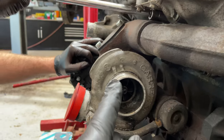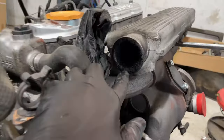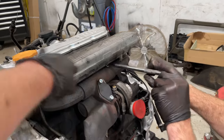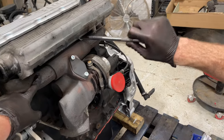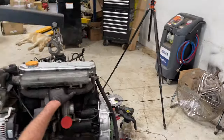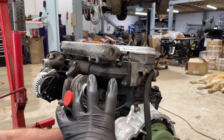So we're essentially now going to be removing the inlet manifold. We're going to be cleaning that because the EGR has made a bit of a mess inside there. We blanked that off as part of the conversion. You can see all the coking up of it. We're removing that, cleaning it out, giving it a spritz of silver. Then we can get to the turbo manifold itself. We'll remove that. We'll remove the turbo drain feeds. We'll spritz this black. We'll change the cartridge, which is there, and we'll spray the outer casing in an aluminium silver. We should be able to get to the block then. We can paint the block a little bit. Again, just a bit of a spritz up. And then this engine will be fitted to the engine bay.